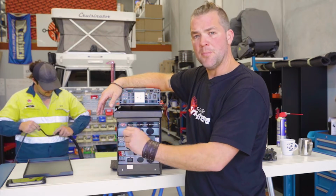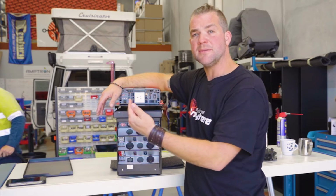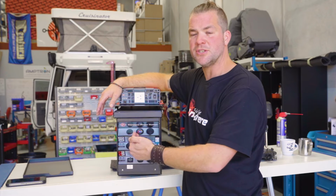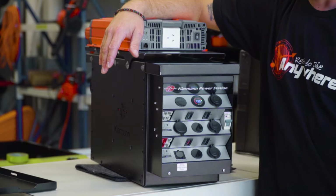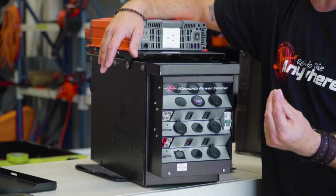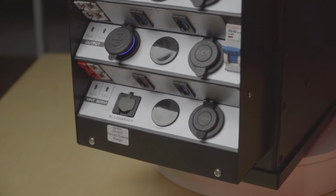When you connect your ignition source here, just be aware that when you use the pre-wired NL5 cable, both cables that go in there, the black and the red, are internally connected to the ignition trigger. So it doesn't matter which one you use, but please do not wire it up with positive and negative. All it needs is one ignition trigger. You can use black or red or both, but only one ignition trigger positive signal to go in on either the black or the red or on both cables. Doesn't matter, they both go to the same ignition trigger input for the DC-DC charger internally here.